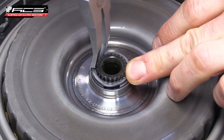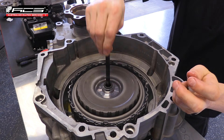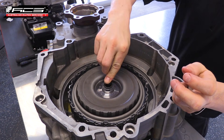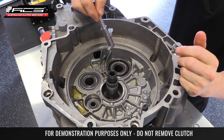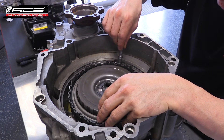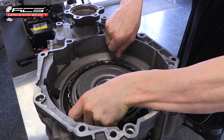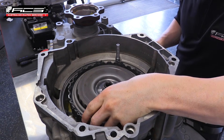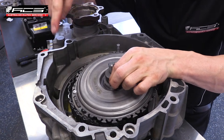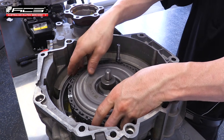Find the closest required snap ring shim size in the pack supplied using the vernier calipers. Remove the 2mm shim and install the correct snap ring shim on the end of the input shaft. Reinstall the oil pump drive shaft. Install the special dual clutch installation tool between the clutch and bell housing to hold the clutch basket in the raised up position. Install the top of the basket, taking note of the orientation markings in relation to the bottom of the basket.